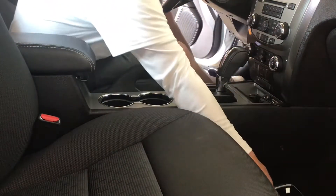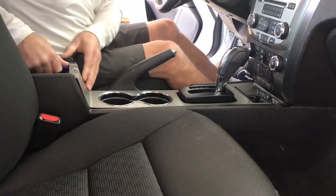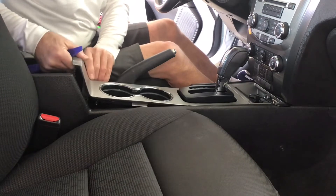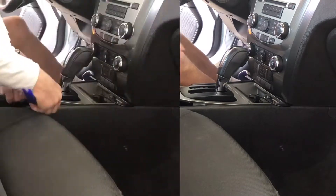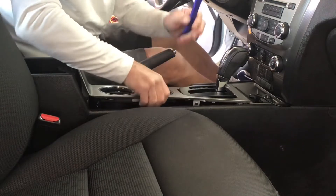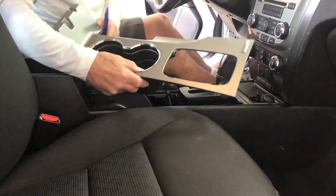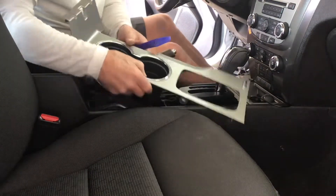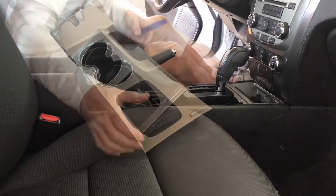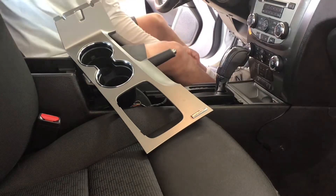Now to the front of the car. Remove the plastic chrome bezel — this piece came off just using my hands. For the other pieces I recommend purchasing a plastic trim removal kit. You can use a screwdriver but one slip and you're going to damage something. Remove the cup holder assembly and put it to the side. Now to the forward section where the power point is — it's the same technique using the trim tools to release the clips.